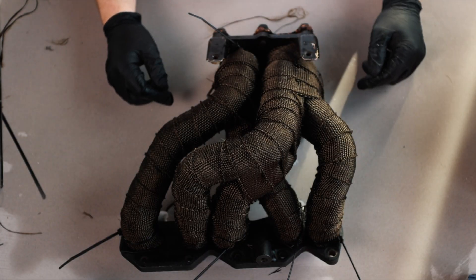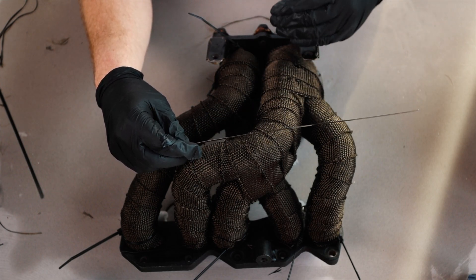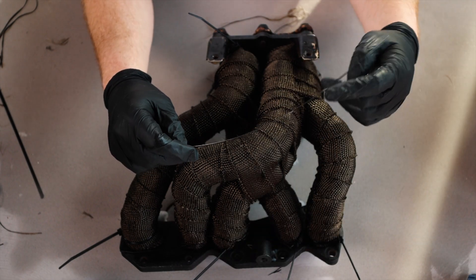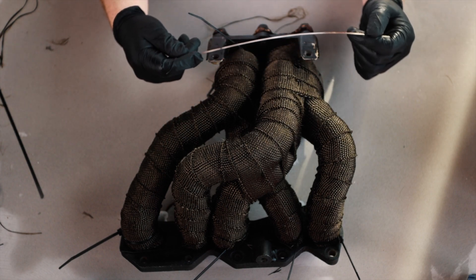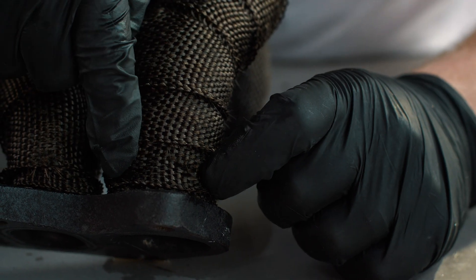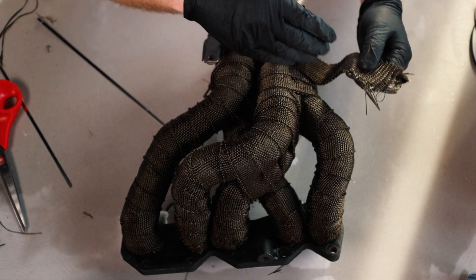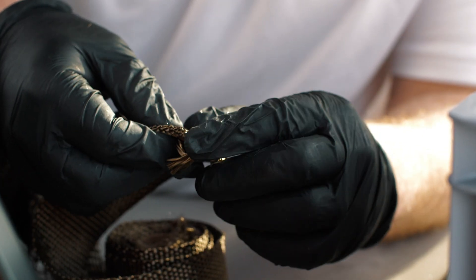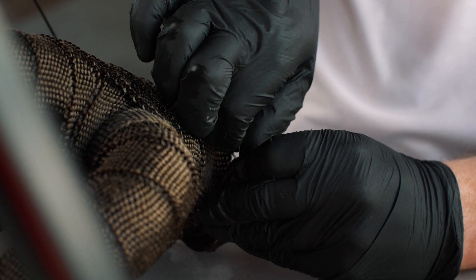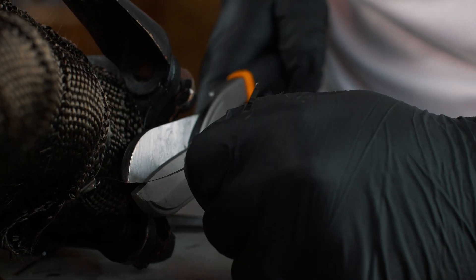There we are — most of the wrapping is complete. All that's left is to fit our stainless steel ties. Down the collector end you definitely need them. Down this end, if I remove all these zip ties they should hold the exhaust wrap from coming up, so I may leave that, but they're definitely recommended at the top end. To finish up the ends it's exactly the same method as how we started — using the anchoring method at a 45-degree angle. The metal locking ties are really simple to use: just slot in like this and that's where your pliers come in handy. To avoid a sharp edge, cut it and then fold it over on itself.